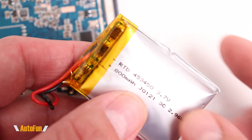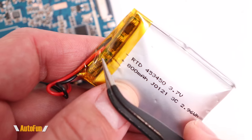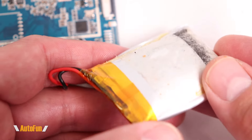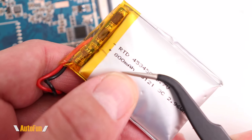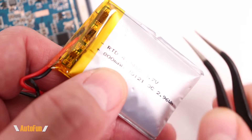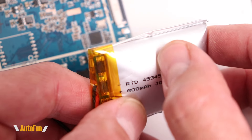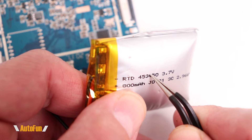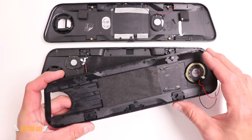The last thing I want to show is a close-up of the battery. It actually has two parts: the battery cell itself, and the BMS — battery management system — which ensures the battery is charged correctly. Because it has ballooned, there could be a temptation to poke a hole in it to relieve the pressure. Unfortunately, lithium batteries can potentially catch fire if the internal material is exposed to oxygen, so it would be very dangerous to poke a hole in it here.